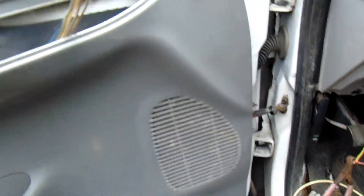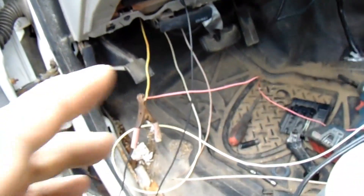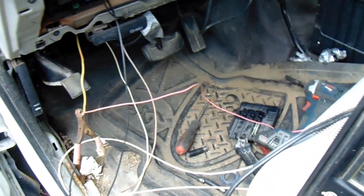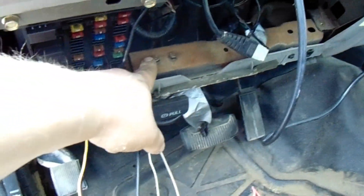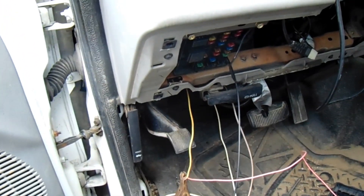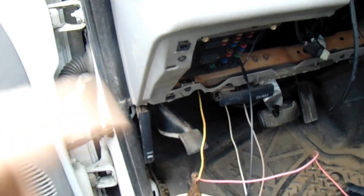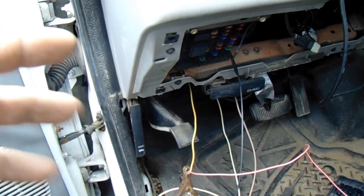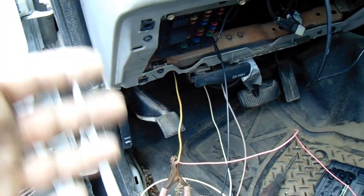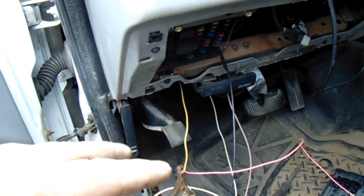Now we know that it works, I'm going to put all this shit where it belongs. I just got to clean up the wiring, run that wire properly under the dash somewhere. I'm not going to run it all the way back around like they had it in the parts truck - I'm just going to run it under the dash and zip tie it up somewhere, because whatever, it works. That's a nice looking ground right there - clean it up. The only thing I got to find is a switched 12-volt source. I'm going to do some poking around in the fuse box, maybe even the one under the hood, to find something that can handle at least 10 amps.